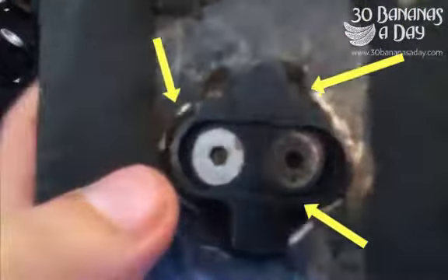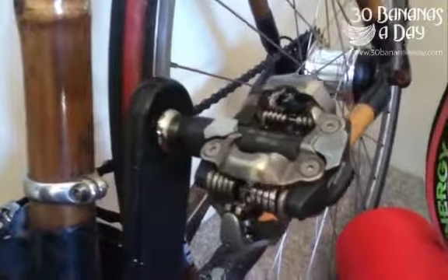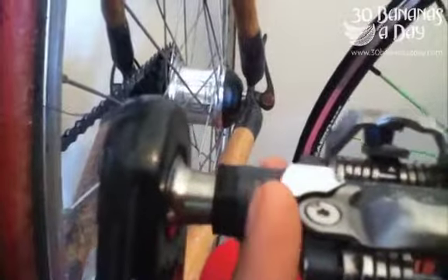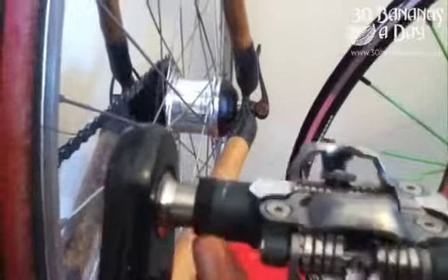What I love about the Shimano pedal is it's incredibly durable. There's not a pedal on the market as durable in my opinion. I've ridden all the pedals — I've ridden the Times, the Looks, the Eggbeater Quad TI which were light but really flimsy. The Shimano XTR pedal, I definitely rate it. This is the latest one — you can see they've moved the axle a lot closer to the crank, which is probably going to give a bit more bearing longevity. And it's a serviceable pedal, but these bearings just keep going and going.